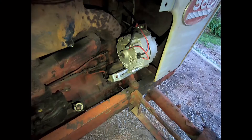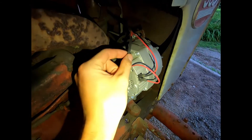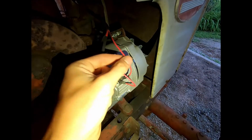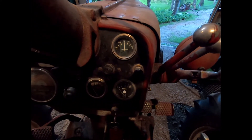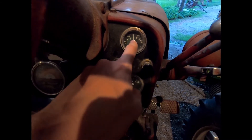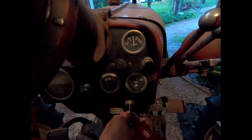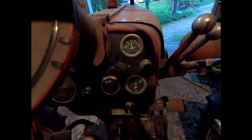The wiring is the next part — I've got to wait for some 10-gauge wire to come in. Here's an overview of how it's all wired up from the back side. I'll show a wiring diagram, but here you can see the exciter wire that's wired to the battery, and this 10-gauge here on the back side goes towards the battery. I personally wired it into the ammeter. This one in the number one position runs to key-on. The 10-gauge off the stud of the alternator goes to the ammeter, through the ammeter, and then another 10-gauge wire comes out and goes towards the battery. I think it's 18-gauge that goes to key-on, and that little exciter wire comes off the battery.